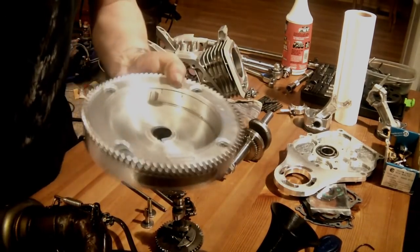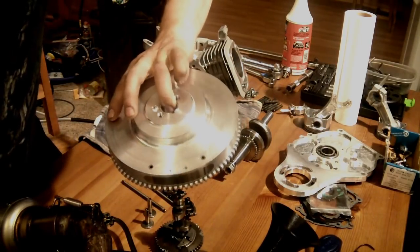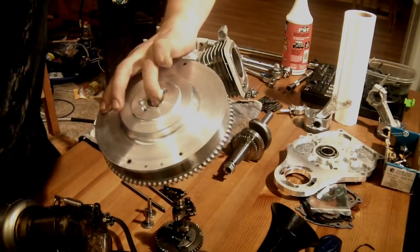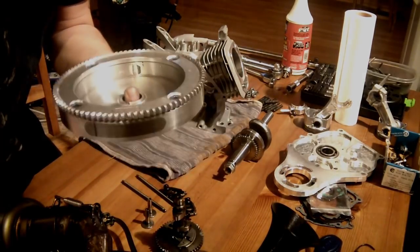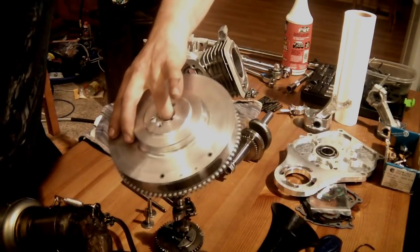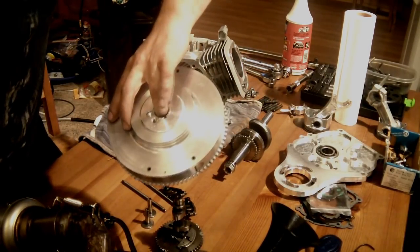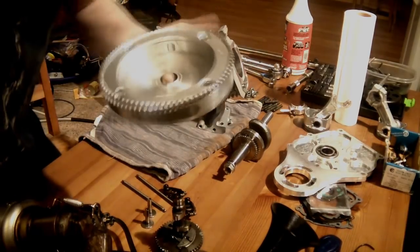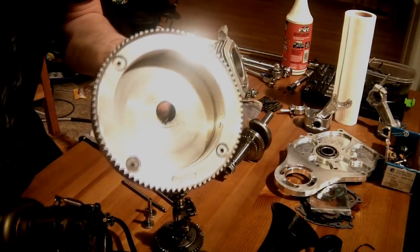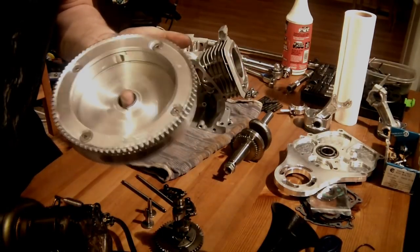This is a crucial part — this is a custom part. But originally this started out as a billet flywheel from Arc, just a basic full-size one. I have machined the fins off because the propeller has a cooling profile on it for a Monster 185, and so far it has been sufficient to cool my engine. I also added a ring gear for a starter — this is an Arc ring gear for a GX200.